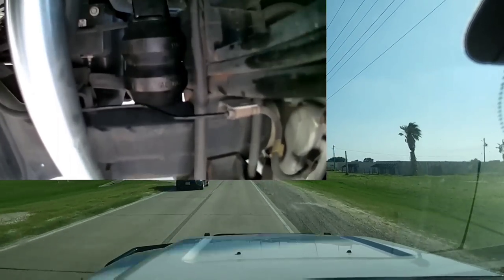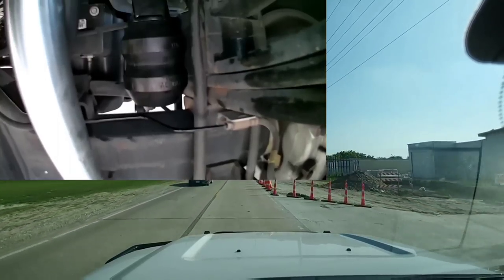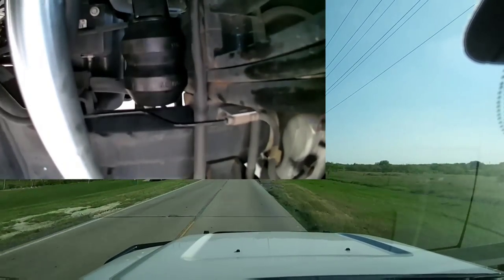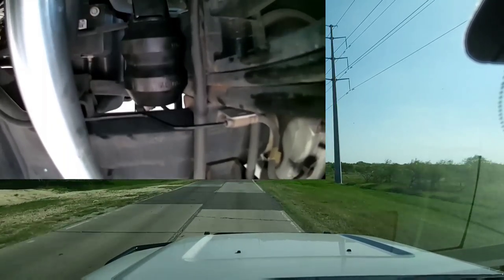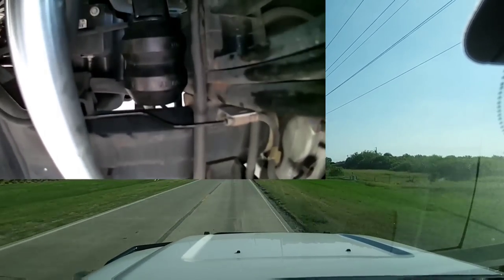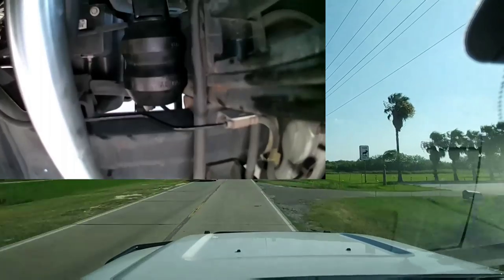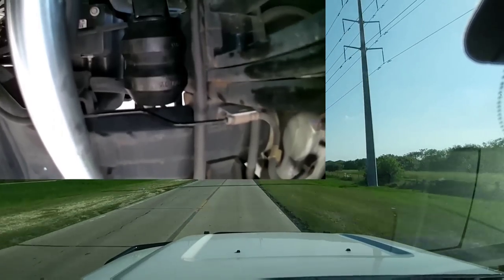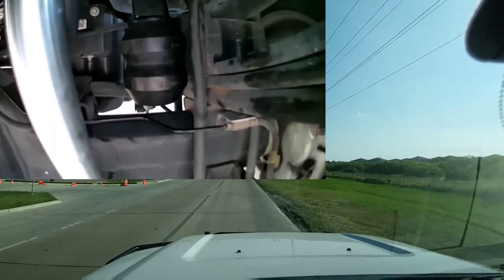The ones I have on here have a 12,000 pound payload capacity — pretty crazy. They work exceptionally well. Once my suspension starts to squat beyond an inch is really when they kick in — that's why you don't see any real contact between the axle and the Timbren. It's not going into effect until I hit a really large bump or I have a big load in the back. They work very, very well. I'm going over that same rough stretch of road I used in my shock review to show you how effective they are. I'm a huge fan. There are just no failure points — you don't have to run lines, you don't have to have a compressor, you don't have to worry about equalization or one failing.